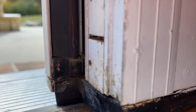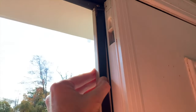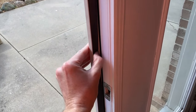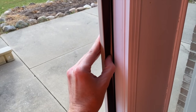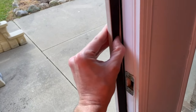Now for a close-up view — as you can see the weather stripping is flush, and I am satisfied with that. What I recommend doing from here is going all the way up to the top and — try not to give yourself weather strip burn or rug burn — just run your thumb or fingers the entire distance to ensure you have properly seated the weather stripping and rubber grips inside that seam. As you do that you may hit what feels like a lump or bump; focus on that area for a few seconds and really seat that inner grip portion of the weather stripping, then continue all the way down.